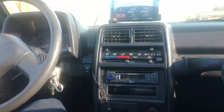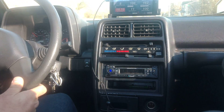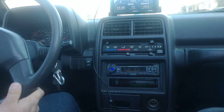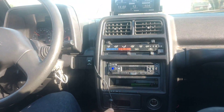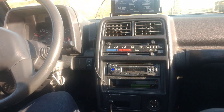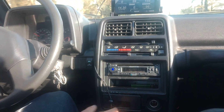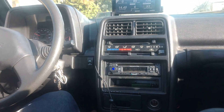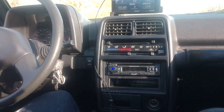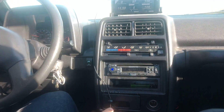I have it set up so that you pull this back four times and it'll be in overdrive lockup. There's no engine braking in this transmission except for third. I'm in second right now — it's just like it's in neutral. If you shift into third there'll be engine braking, but fourth has none. So only third has the engine brake clutch engaged.